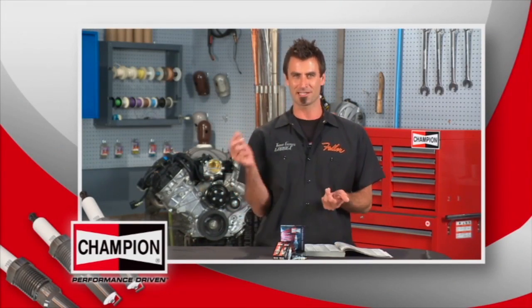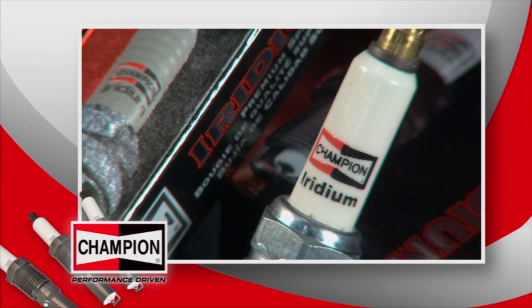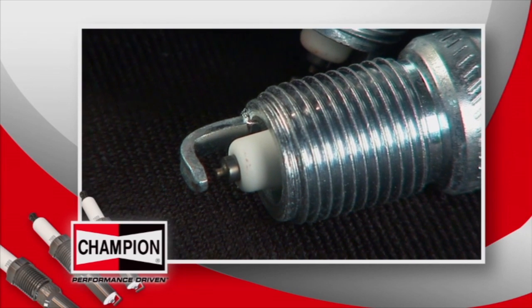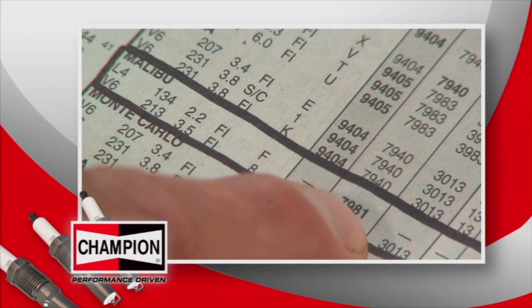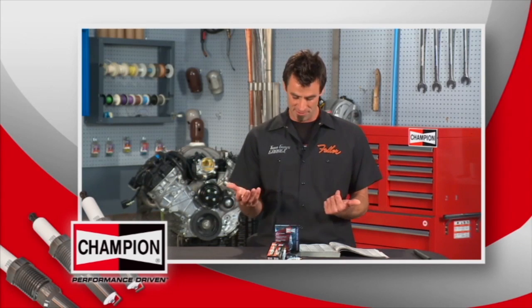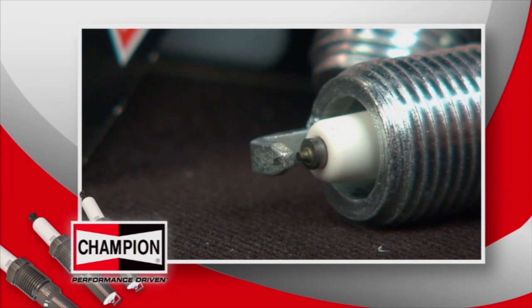You may have heard of Iridium. Iridium actually fell from the sky — it's a precious metal that landed here in a meteor, and it works great on a spark plug because it has great resistance to the corrosion going on in an engine, plus low resistance to electricity. So the electricity gets through and makes a nice hot spark fast. If you look in a book like this Champion spark plug book, check out the Malibu — two different models: one uses a double platinum plug, the other uses an Iridium plug. It actually takes less voltage to run the Iridium plug than the double platinum. So be detailed and make sure you get the exact plug made for your vehicle.